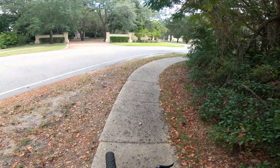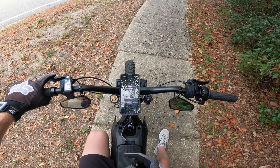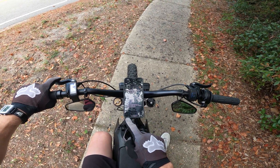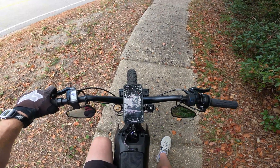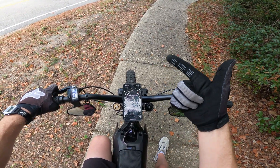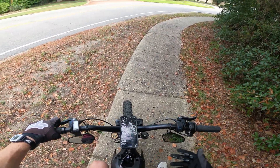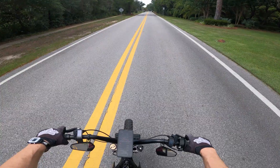We're bumping to 10 amps of field weakening, and we're also going to be trying to get up to 55 miles an hour towards the end of the video with more field weakening. The app recommends limiting the current to below 50 amps to minimize potential drawback. Field weakening has its advantages and disadvantages — the advantages are more speed and more torque at high speed; the disadvantages are less range and increased motor temperature.